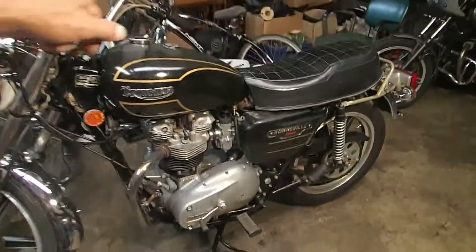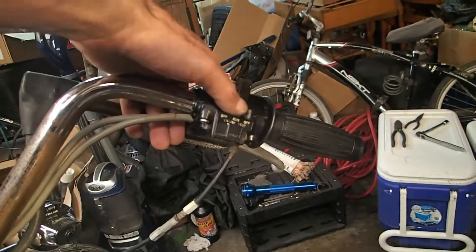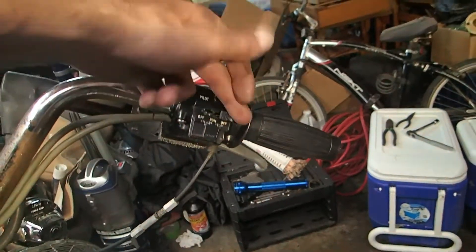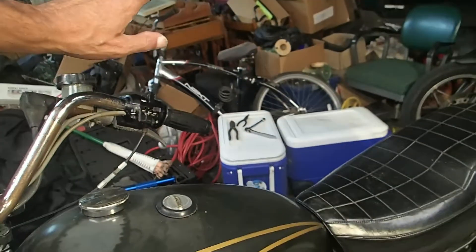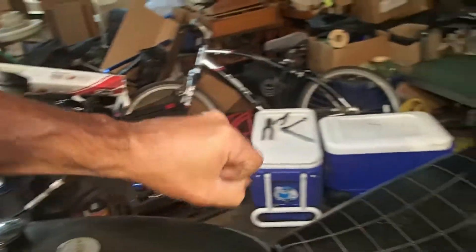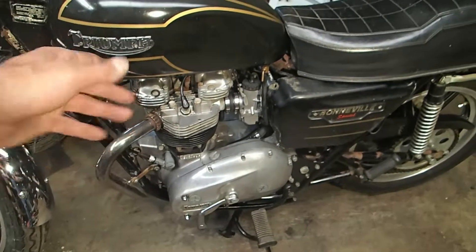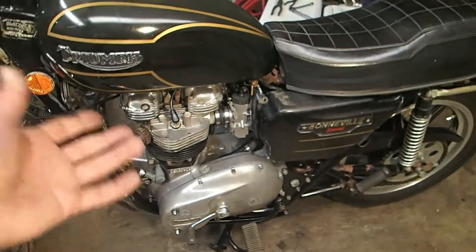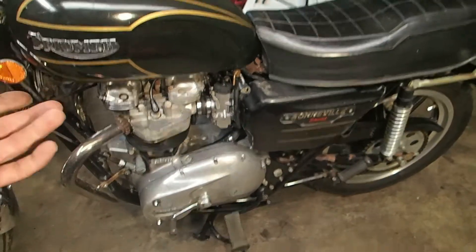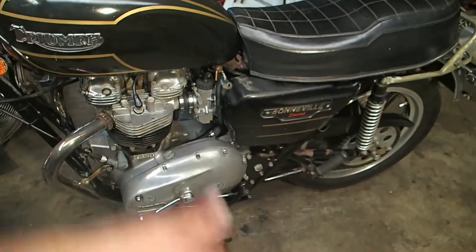Every time I flip on the run switch — yes, I know my run switch is on/off, but that's the only way the bike will start, I don't know why. Anyway, every time I flip this switch between tries I get a big poof, which is the plugs popping off. The plugs are sparking inside the cylinder heads, burning off all the gas in there, and that's kind of telling me I'm getting too much gas — I think I'm running rich.